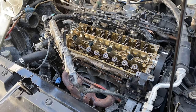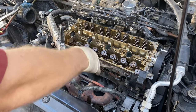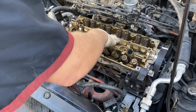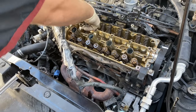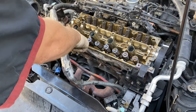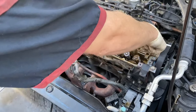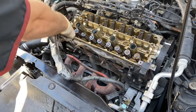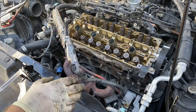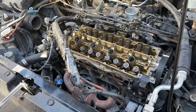The bolts have to be done in a specific order, starting with the middle. Always start with the middle, so you're working your way out. You're going to go top two, either one first, and then the opposing bolt, jump back over to the opposing side, and then finish up the X pattern. Now for the last one, do the farthest bolt away from the final one in the center, and then start the X pattern again. So you jump back over to this side, then here, and jump back over. You're going to do that sequence every single time: 14 pounds, 36 pounds, and then 49 pounds.